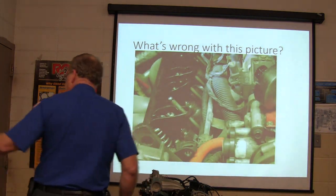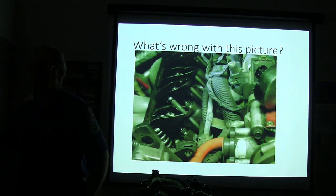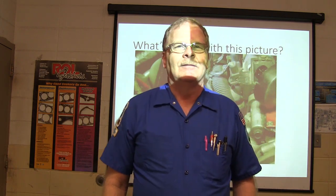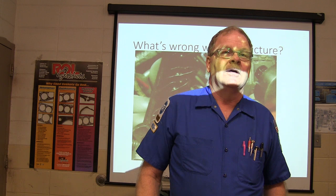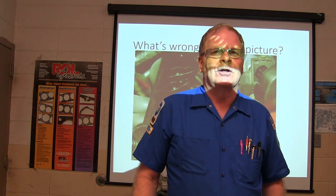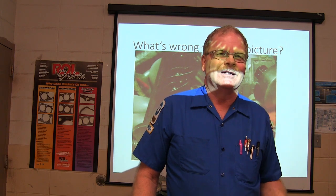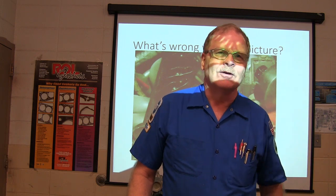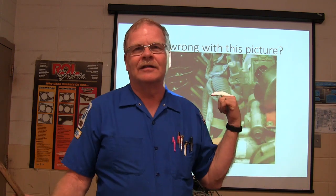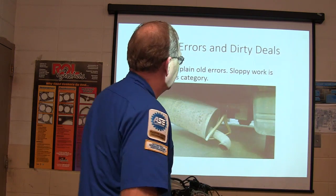What's wrong with this picture? There was a bunch of them that went through this truck. I think the engine maybe floated some valves — running so fast and hard that the pistons hit the valves before they had time to close. There was a truck that came into Donnie's shop with several of these, and it seemed like it had oil wear at other places too.